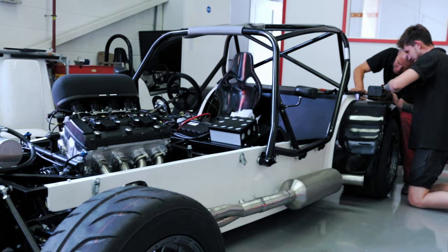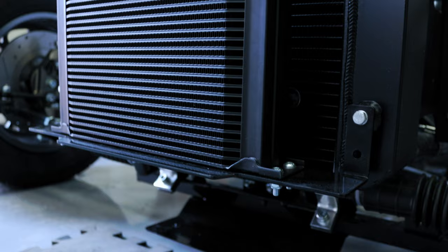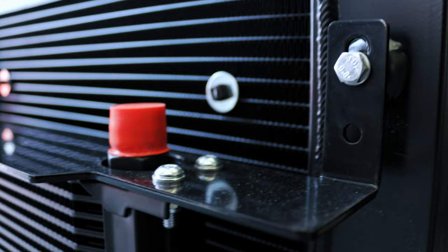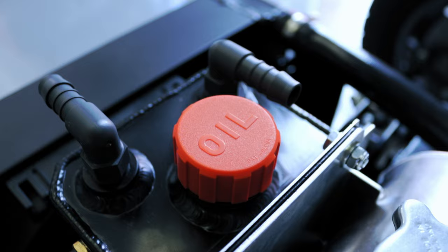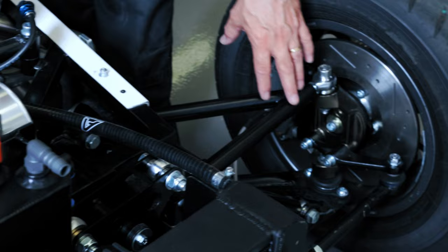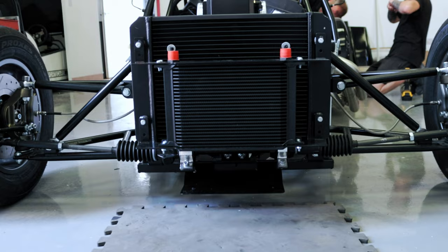So we'll start here with the Cup 200. We spoke a lot about this last week and we're rattling through it quite quickly. Quite a few bits done. The oil cooler bracketry is all done — this is a 25-row oil cooler with a slightly elongated hole to fit both the 19 and 25 row variants. We've black-packed them out. The header tanks are all done. Brakes have all been bled and we've done the geo on the car. This is a new top wishbone setup with the M14 top rose joint — a bit easier to adjust and with more adjustment range on it.